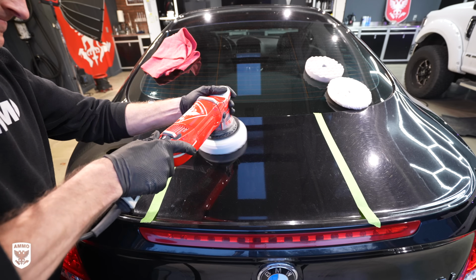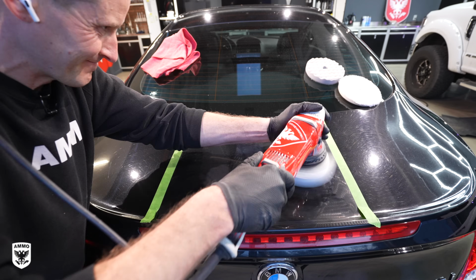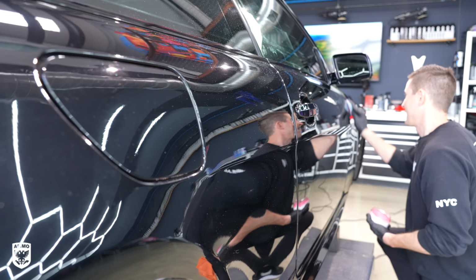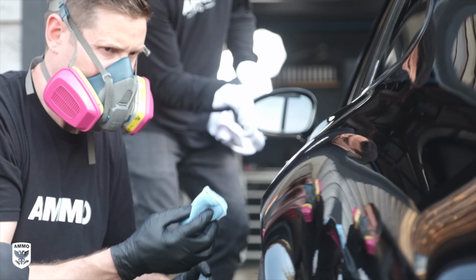Section 2 looks even better. The swirls are mostly gone. The paint looks slightly deeper because the swirls are no longer distracting your eye. This probably takes about an hour or 2 of polishing, but you do need to allocate some time for adding extra protection afterwards. So again, keep that in mind. Anywhere from 30 minutes to 2 hours if you decide to use a coating.